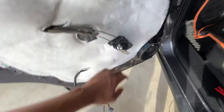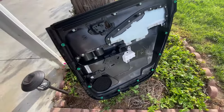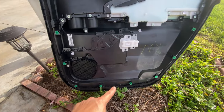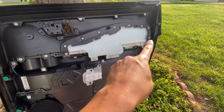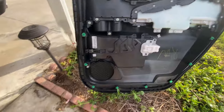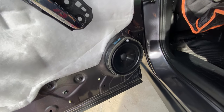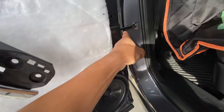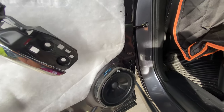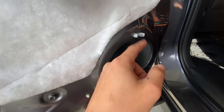Here's what it looks like with the door handle popped out and the wiring harness clip disconnected — you can see the door just hanging there. There are ten of those little green clips total. The next step is to unscrew the speaker, because that's how we access the door checker. Pull the speaker back and then feed in the new door checker.